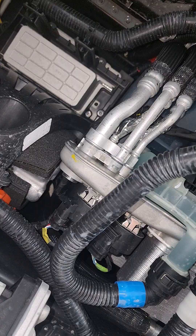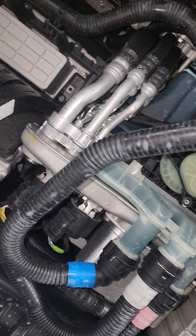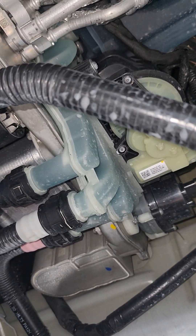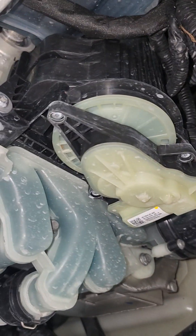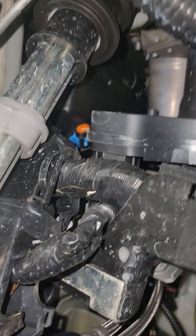This is what it looks like when you remove the bottom skid plate. This is your AC system here. There is probably a good 12 to 14 inches of more frunk that they could have put in here, as far as under the hood or bonnet, whatever you call it, for the trunk space. Remember, stay away from anything orange unless you are trained and understand what that is — in a nutshell, that's extremely high voltage. If you want to feel what 1.21 gigawatts feels like, go ahead and give it a touch — that's not recommended. That is just for information purposes. There's your steering, electric steering rack and pinion. That is your AC system. And it looks like some other kind of hydraulic unit over here — oh, that's the coolant, which probably makes sense for the radiator. That's an amazing design. Here's your electric motor right there for the steering column.